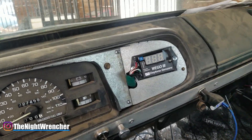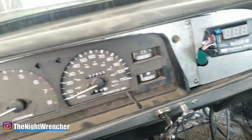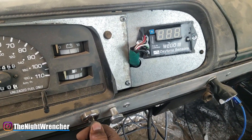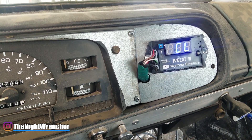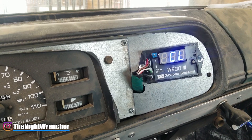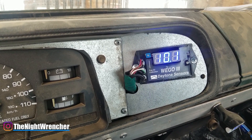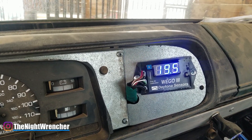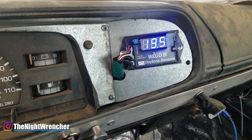All right, that took a while. I actually ran out of spots that had fuses inside my fuse box so I had to do a little bit of creative workarounds to actually get everything wired up. I've already got everything done so let's try to actually get this thing started. Okay, we've got a CL — it must be like a calibration or a preheat. All of these wideband O2 sensors do have to get preheated before they actually start functioning, and as you can see it says 19.5 which means lean, but in other words it also means that the engine is probably off.